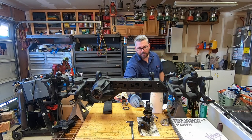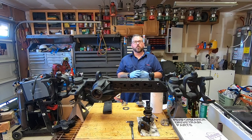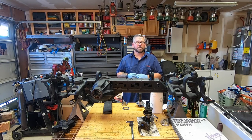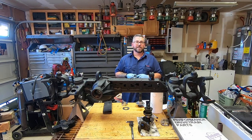I also want to use the old nut for helping me set up, but I don't want the threads to cut into the new pinion gear since they are designed to bite down so they have zero chance of coming off. If I run it in and out a bunch of times during setup, I don't want it to ruin the threads. So I took my Dremel, went in the center a little bit, then actually took a tap and tapped it out — ran the tap in and out a bunch of times and made sure it screws on smoothly. A new nut, washer, and all the shims I need come in the kit, so I'm not reusing anything other than what I've made for setup.